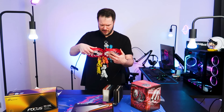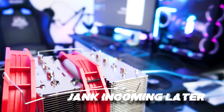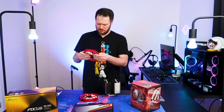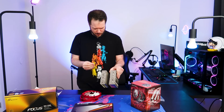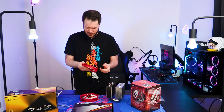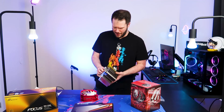Looking at the back of them, both are 12-volt DC fans, both 0.25 amp, and I don't know why they decided to go with different headers. What bothered me more than anything was their mounting system. They basically have these little rubber grommet tabs that are meant to press onto the cooler via these little holes. It includes typical fan mounting clips you see on most other air coolers, but there's not really a good way to mount these — you'd have to stretch the clip across from the top or something. We're still going to put together a test system today — just a B550 motherboard, a power supply, and an R5 3600 to run some thermals, minus the fan mounting issues.